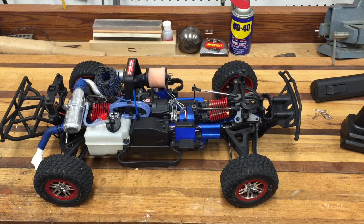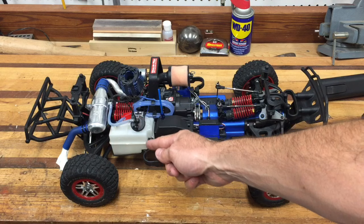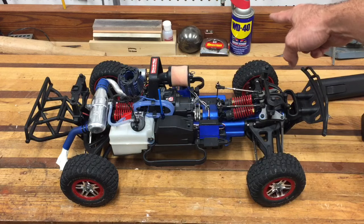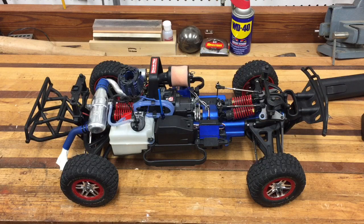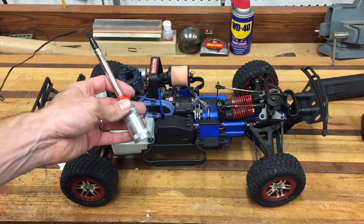You really need to think carefully if you want a nitro vehicle. They are kind of finicky in terms of tuning — everything has to be pretty much perfect for it to run. There's really not a lot of room for laziness or sloppiness. Every time you run it, you need to empty the tank and put your WD-40 into the intake as part of your after-run procedure.